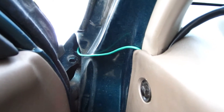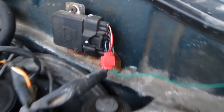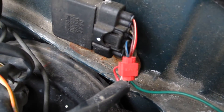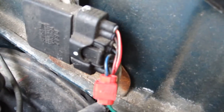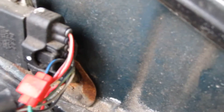Now for the fourth wire — the green wire. I ran it right through here, through the fender, and ran it to the ignition module. I went online and searched which wire off the ignition module had the actual signal source. It turned out to be a black wire with a blue stripe. Make sure you get the right one because you won't get a proper signal without it. There are little splicers that came with the tach — usually about two dollars at a store — and I just spliced it on there.